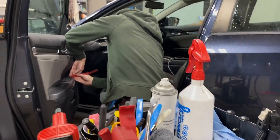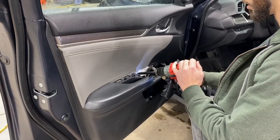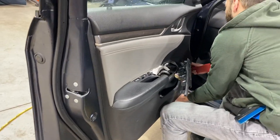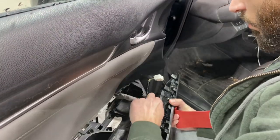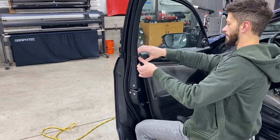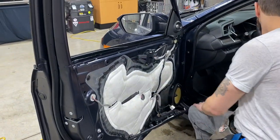This is the Equalizer Pry Baby tool kit, that's 2305GB — comes with a bunch of different tools. Here we're using a Skill bit set, that's FS4VSD, just unplugging the electronics and popping the door card. Pulling the door card on this one is very easy. Then plugging back in and pulling the window strip out.